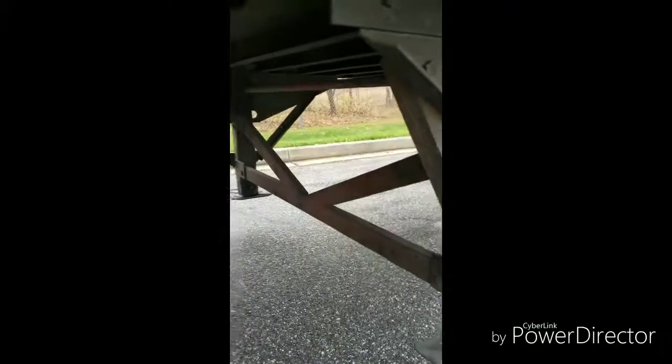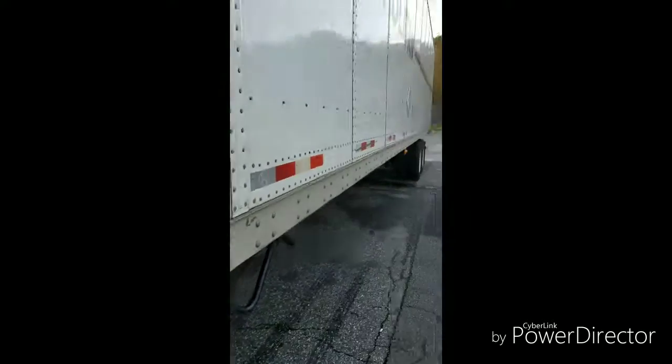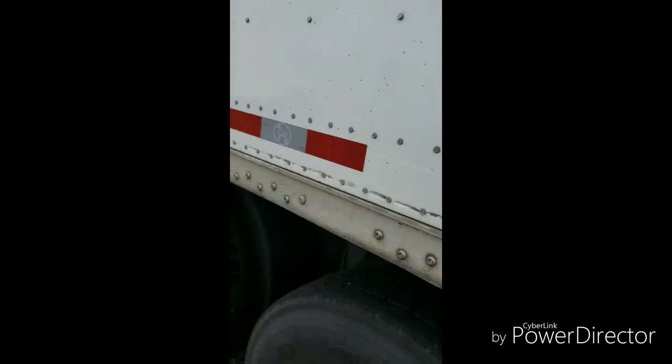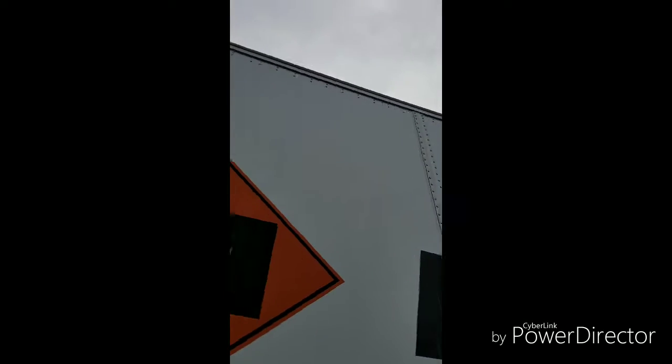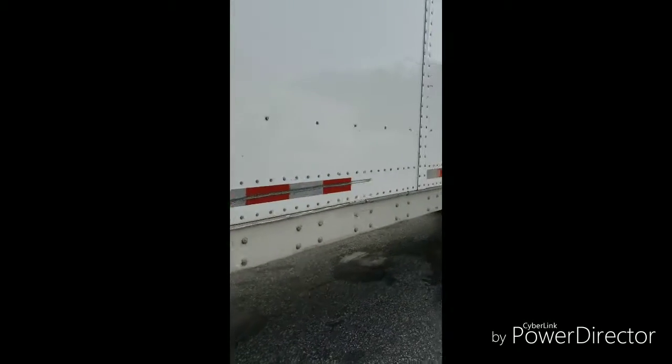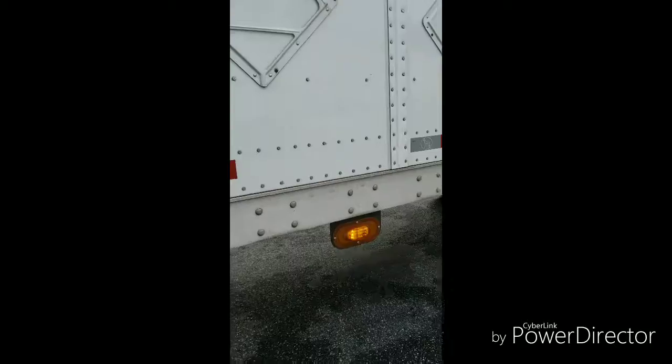While you're under there, look at the ribs underneath your trailer — they're part of the structural support. Under a heavy load, if more than three of those ribs are bent, they can put you out of service. There are rails at the bottom and a rail across the top; both of those support the structural integrity of the trailer. Make sure there's no damage to them.